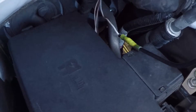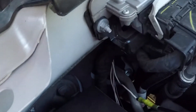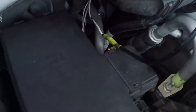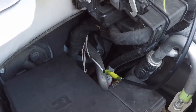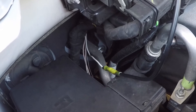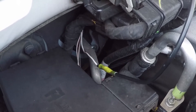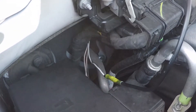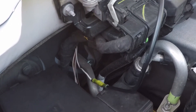There are four pass-through wires — I believe they're 14 gauge — electrical-taped to the main harness. On the firewall, underneath where all your plugs are by the fuse box, there's a harness with four wires: a white and purple, a gray and orange, and a white and orange. Those are your pass-through wires. They just pass through the firewall — no connectors or anything. I have my light hooked on one of those already.